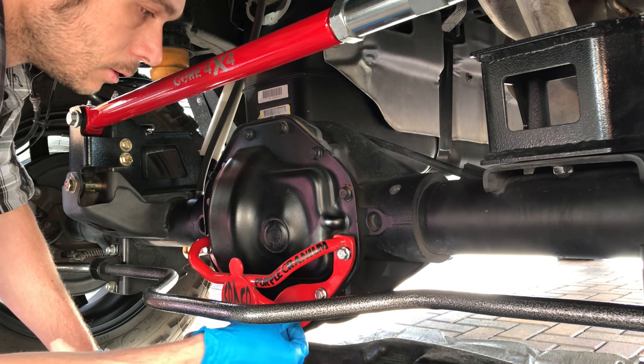So what I'm going to do is a couple coats of this. This is basically what's covering the entire underneath of my truck, besides like a rust converter or something like that. Oh, damn, the little rubber piece here. If you got one of those, I suggest you leave it on there when you paint it because it seals better to the bare metal surface under there. You can paint over it, it doesn't hurt it. It's just going to flake later.